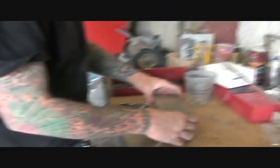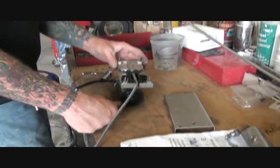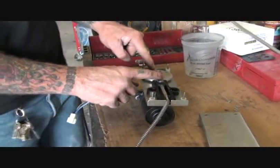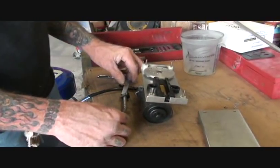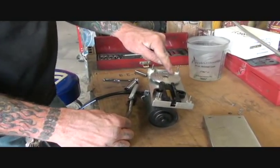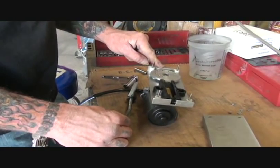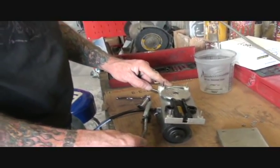Just take the plate off of your motor. Now look and see which hole is aligned up where it's straight up and down. I'm going to take the cable out. The farthest hole from the center — you want to go three in. That's where it should be set for the Street Beast car, so the sweep of the blades will be at the stopping point that you want.